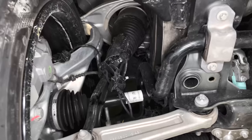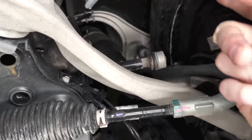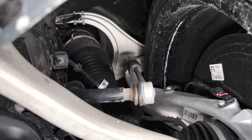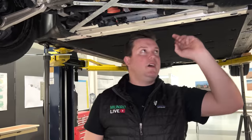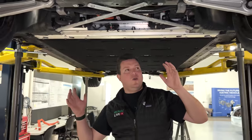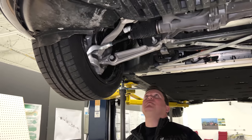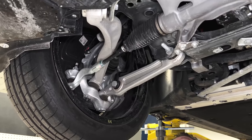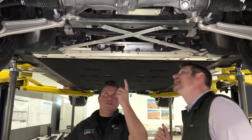On the other side, this has sensors to track the movement of the suspension, but from what we can see, the link is bolting to what appears to be a snap-in-place bracket and is not actually fastened to the control arm, which is certainly atypical. These sensors are on all four wheels — some OEMs will mount to the left front and right rear to detect roll or variation, but monitoring on all four suggests the system is actually pretty advanced. This is an air suspension system, so it's not too groundbreaking.